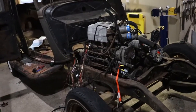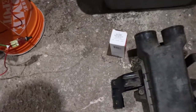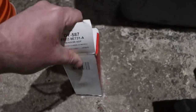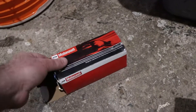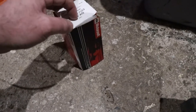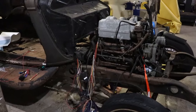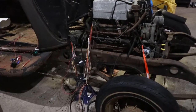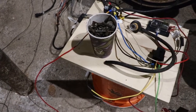This uses an EEC4 computer and it needs a vehicle speed sensor. When they lifted the transmission out they damaged the speed sensor, so I picked up another one. It does not come with the gear — I have the gear still. They also damaged the kickdown system, so I'll need to go into the transmission and change the kickdown actuator. I also had to go to another junkyard to collect nuts and bolts — about five dollars worth.